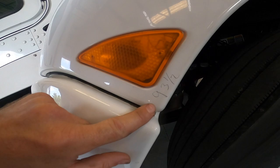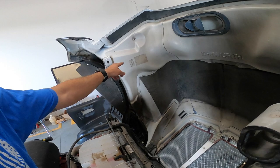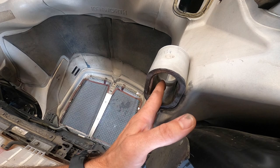That tells me once I get the fender off and the inner reinforcement starts fluctuating, I want to make sure when I glue it back in and clamp it, I keep it about 93 and a half inches wide to bump the fender out just a little bit and make it line up with that chassis skirt better. I did the same thing with the inside cups that fit on the guides — measured it at 47 and a quarter, from the inside of that cup to the inside of this cup. That'll give me the proper measurements so when I put the hood back on, it'll push the fender out some and line up better than it did before it came in.